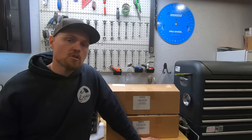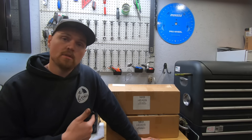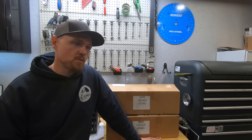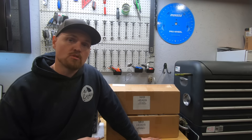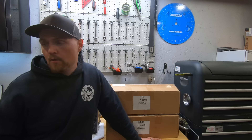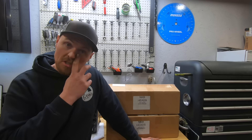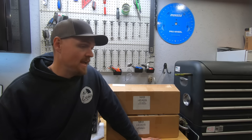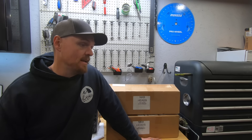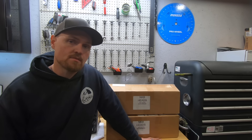Flow numbers are great, visual inspection is great, but at the end of the day we want to make power. So I'm going to bolt these heads onto an upcoming 383 stroker and dyno it. I'll be swapping over to a hydraulic roller spring and putting in a decent hydraulic roller cam on one of the upcoming 383 stroker videos. For the price point — as long as they make some decent power, which I think they will — it's a really great deal at $800-something bucks for an assembled set of heads.